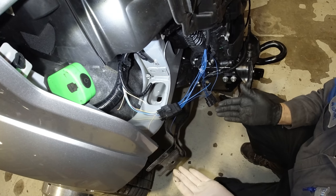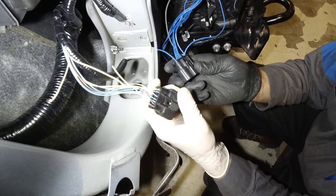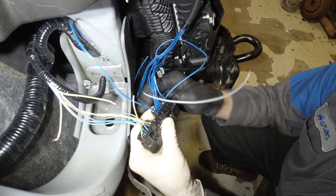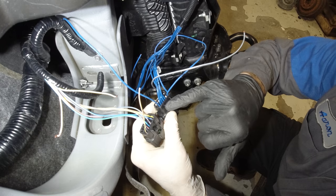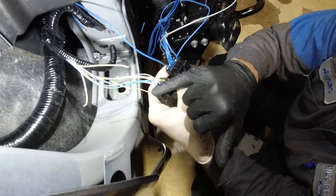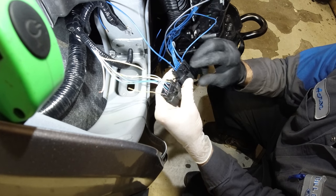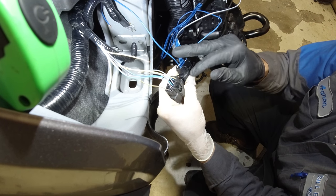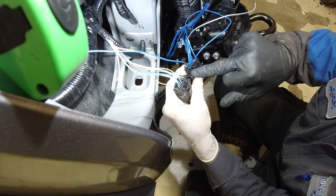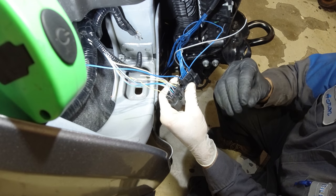Guys, we ran into an issue and the running lights and the high beams didn't work after we plugged and played all of our harnesses. So what I found out was, we have two connectors going to the truck. This pin here was right where this white one was. I had to switch the blank plug and take this pin out and put it here. This is going to our headlight. This is our factory connector. Why was this circuit empty in this plug? They did not have this pinned right. So I had to find the park wire from this harness and it was in this pin. I had to de-pin it, put it in the correct slot so now that it matches this. So we put the headlight in and the running lights now work.